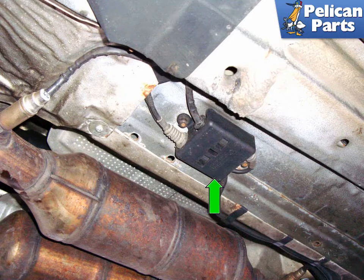This photo illustrates under the middle of the car on the left side. The black cover, shown by the green arrow, contains the oxygen sensor connectors. The oxygen sensors can be removed separately from the exhaust or can be removed with the exhaust. There is another cover on the other side of the car for the oxygen sensors mounted in the right side exhaust.